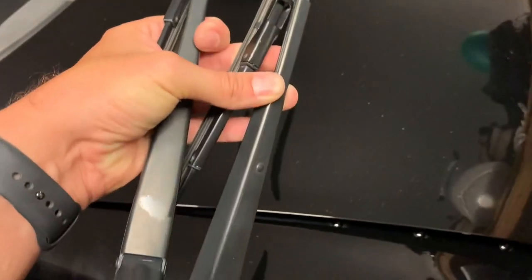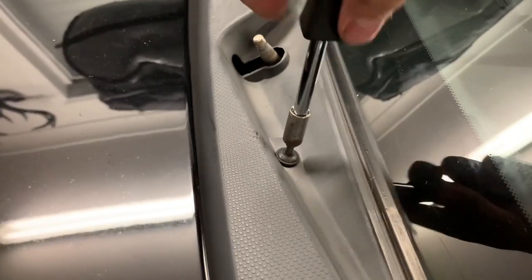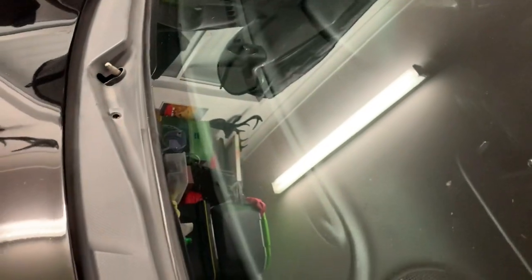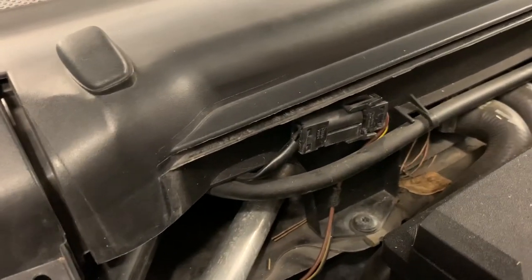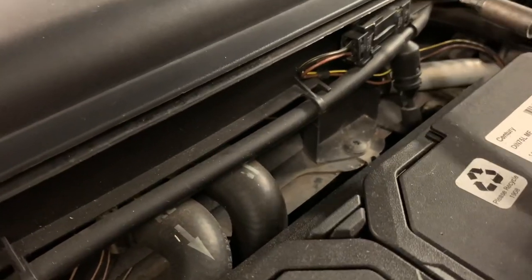Now that these arms are off - you can see one of them has the paint a little bit worn, the other one's okay. I'll give them a little cleanup and a shot with satin black just to make them look new again - might as well, we're doing the rest of it. Now we're going to remove this torx, it's a T25. That's not held in by much at all. Then quick removal of the battery cover, which is just turning the little pegs and pulling it straight off. You've got two more torx screws, remove those, and then there's some clips, wiring, and the windshield washer sprayer connector - disconnect that, then we'll transfer the squirters and clips over to our new replacement cowl.